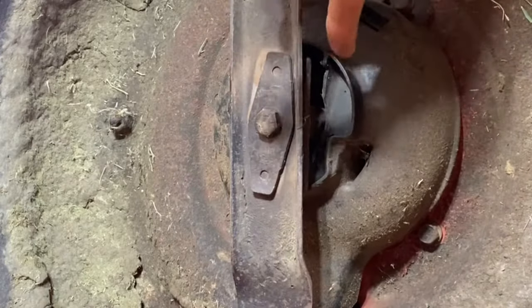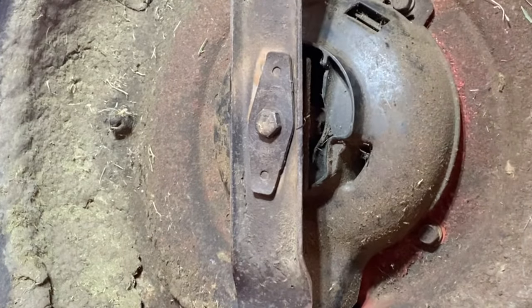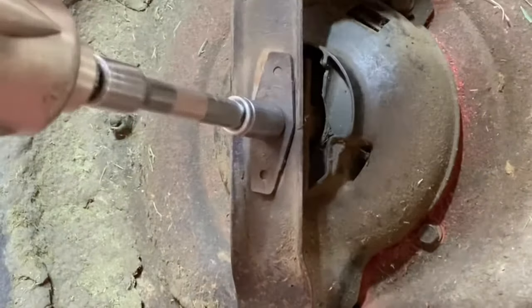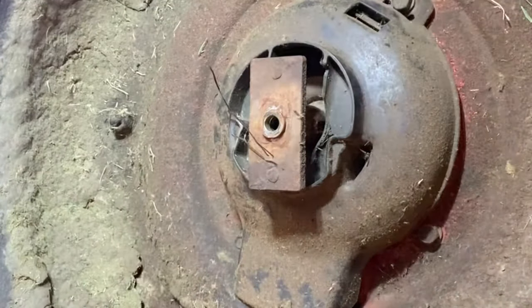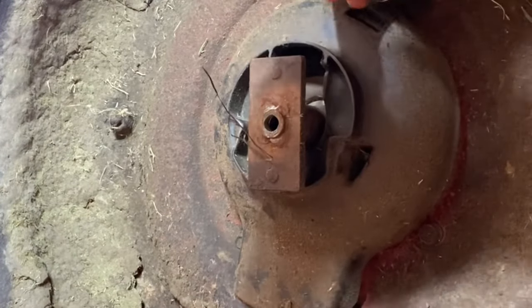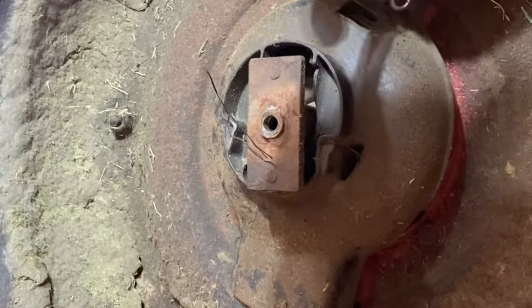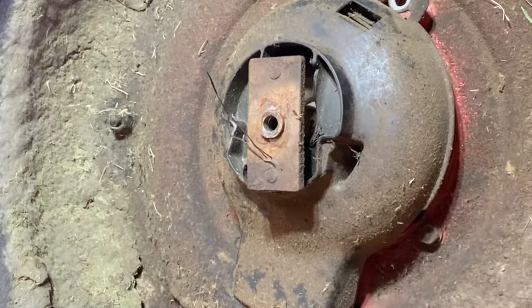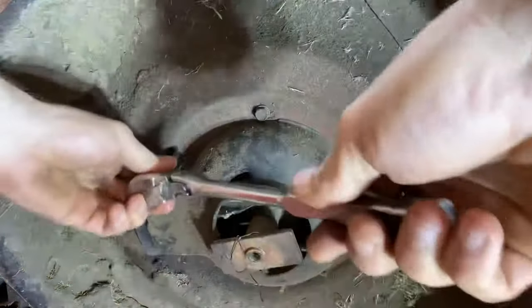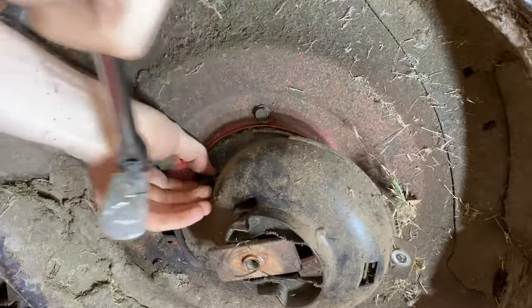The first thing we need to do is take off the blade, and then we can take off this plastic cover in order to get to the drain plug. This blade bolt is just a 5/8. It helps to put her in full reverse to pop that off. Then you've got a half-inch bolt that holds this plastic cover on here — you only have to take off one of these half-inch bolts; the other ones don't actually hold the cover on. On the other side there is one other bolt, a 3/8-inch bolt — it's the only smaller one on there.